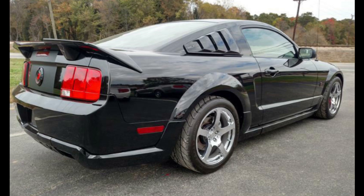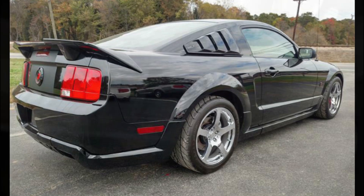Hey guys, Danny Johnson here. I was on Facebook and saw that a kid was trying to put 05-plus wheels on his New Edge Mustang — these are Roush wheels, so they're a little wider than factory. He was saying the wheel was rubbing on the suspension, getting eaten into the shock itself. Everybody was telling him they'd put that size of extra-wide rim on their car before without problems. I explained to him it was all about the offset being different for that year, and therefore he needs wheel spacers.